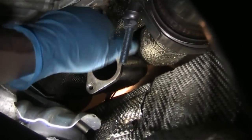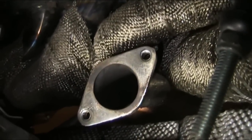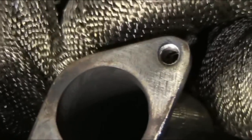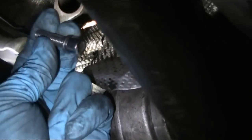I also noticed when I was taking off the wastegate, it was just loose enough for it to actually break the gasket and leak a little bit. You see the dark spot right there - the gasket failed and was leaking. We'll take care of that. I got a hold of some multi-layer steel gaskets for the new TurboSmart one. So that was a pretty cool experiment to see that indeed the cheap hardware does make a difference.